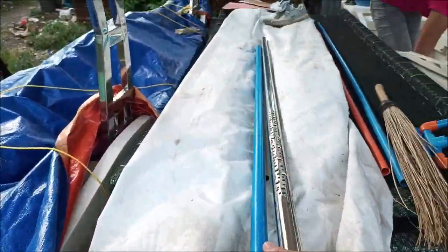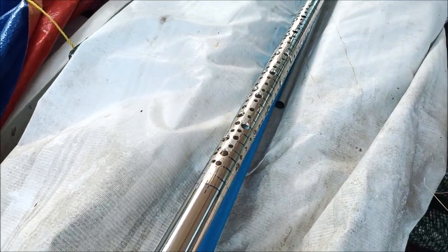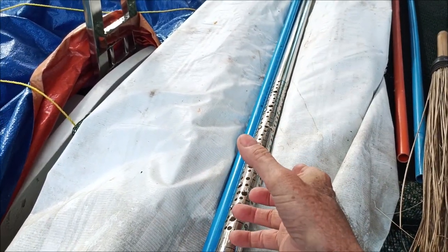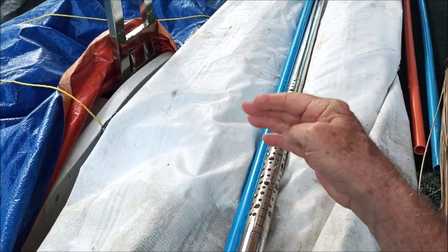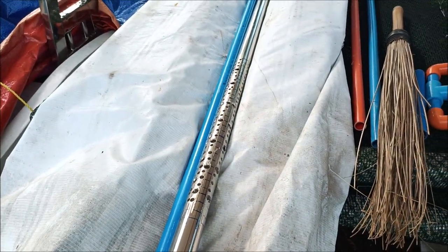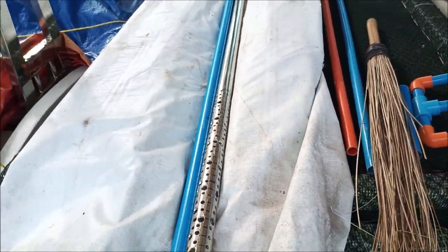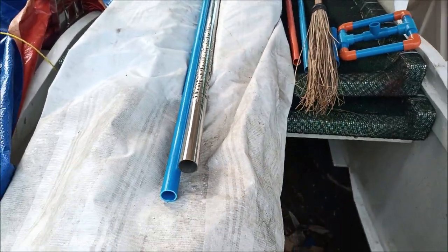And over here, we've got the muffler, the inside of the muffler here. You see all the holes drilled, and we'll cut it somewhere here or there, and then I got a 3-inch pipe that goes over it, and we'll put some stainless steel wool sections, donuts, on this, and then assemble the muffler.